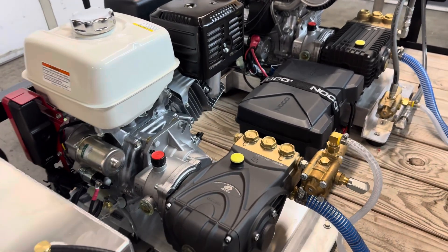When the water moves, if you're hauling water and it sloshes, it's only going to slosh within that 12-inch span. So if you have 200 gallons of water and you're moving, the slosh effect is going to be a lot less. On this particular trailer, I'd recommend not really hauling water — it is a single axle, so this is a small compact trailer. It's going to have everything that the big trailers have on it, but a little bit more compact and a little bit less of a weight rating. I wouldn't recommend traveling around with full water, but if you did want to haul a little bit, this would reduce the sloshing effect.